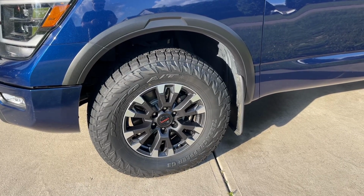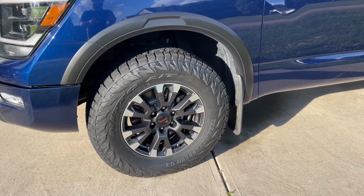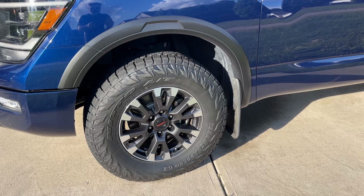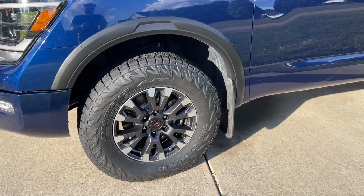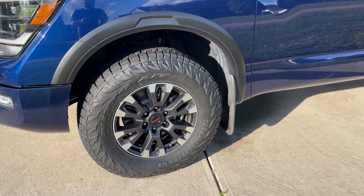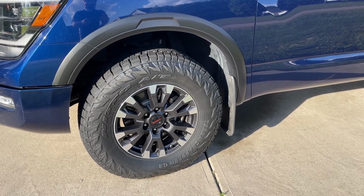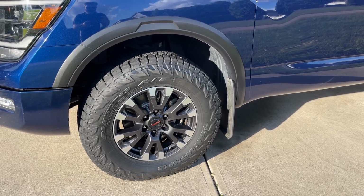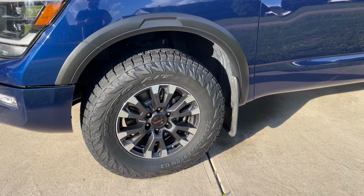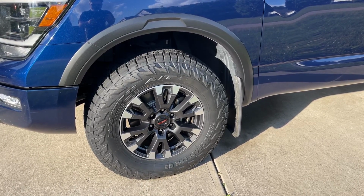Only 2 out of the 4 tires were good without any issues from initial installation. I was experiencing tire vibrations at highway speeds immediately after switching to these Nitto G3s, and I still am. When I went back into Discount Tire to get these tires looked at and possibly rebalanced, one tire's balance issue was supposedly able to be resolved reasonably well, if you call 9.5 ounces of weight on a tire reasonable, with road force balancing. A second tire, this front left one, had to be replaced completely.